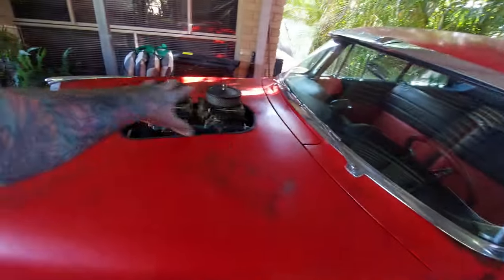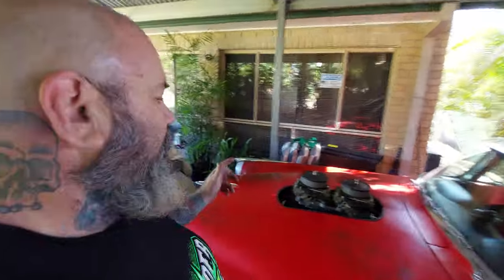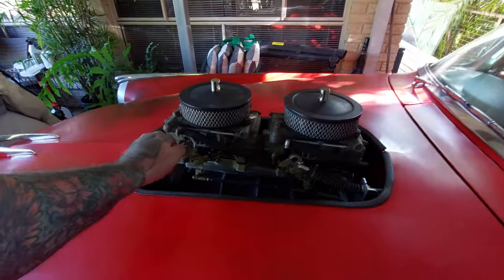Well, hopefully you can hear me. The whole shed's vibrating. Anyway, we had no leakage happening on the top with the fuel pressure. What I've done is I changed that silly filter out and put another one in. Now, it wasn't brand new, but it was still very good and clean. I put another filter in, and straight away, when I started it, it was idling up. It was idling a lot different than what it normally does. It actually sounds pretty crisp at the moment. I haven't checked floats, but...